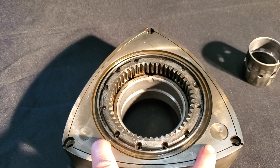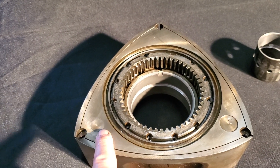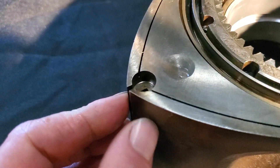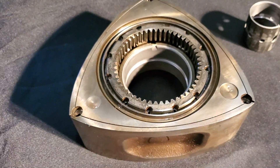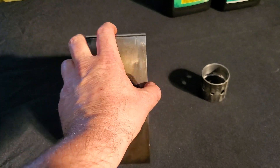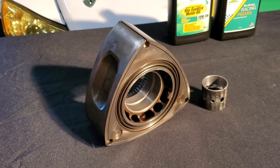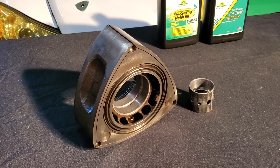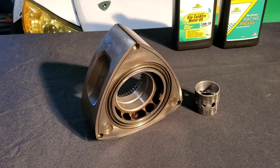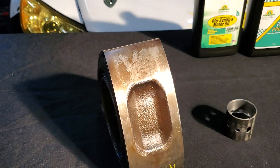These are KMR Mazda Tricks side-cut rotors. This particular motor was not a lightened-rotor motor because it originally started as one of my backup motors, but we've been running it in competition anyway. I always recommend lightening if you have the opportunity, but the side cutting allowed us to achieve that RPM and horsepower without any interference or issues within our side seals or corner seals. The rotor was also balanced by Mazda Tricks — they do great high-speed balancing and have been doing it for 30-plus years with no issues. This motor is long-term proof of that.